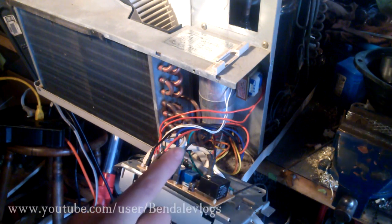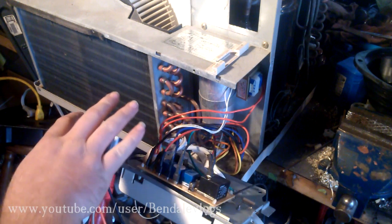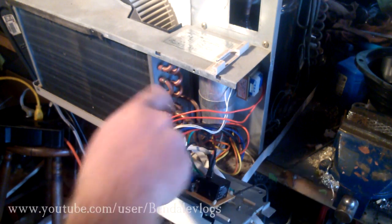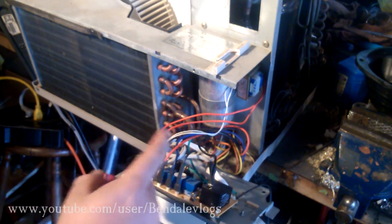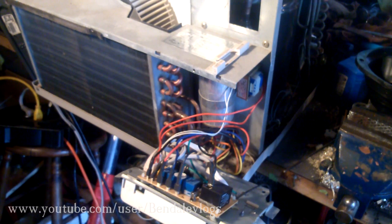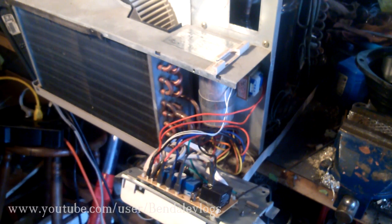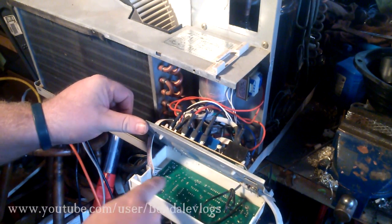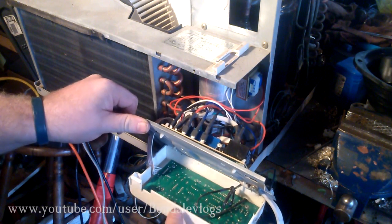The rest of this circuit board could fail in a similar way and it would be very difficult to know. The capacitors on the back — there are two or three of them — you might see them bulging, you might see them exploded, but sometimes they don't show visible signs. Overall, if the circuit board is damaged, the unit is basically scrapped. If you open this up, you can see there are no real user-serviceable parts inside, so I wouldn't even bother.